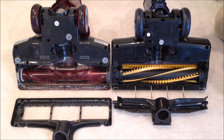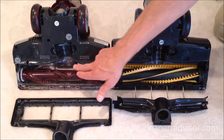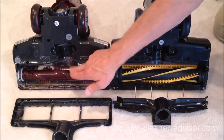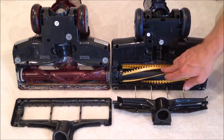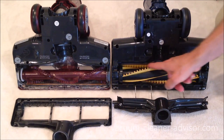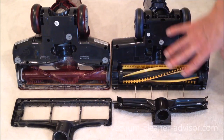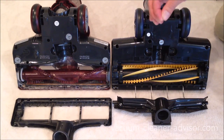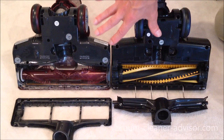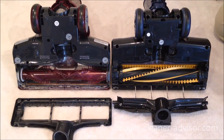One of the main differences is the cleaner head. The NV752 has a fairly standard traditional brush roll with stiff bristles. The ZU-632 doesn't look standard at all — you still have some bristles, but there are blade-like devices, and further back inside the cleaner head is a comb-like device that the bristles and blades pass through. This is designed to strip off thread, hair, and string, ensuring very limited tangling. The NV752 does not have this feature. Later in the video we'll do a hair test to show the difference.